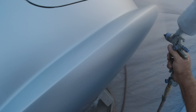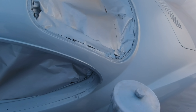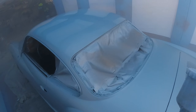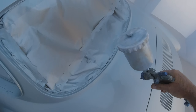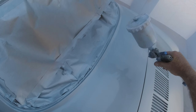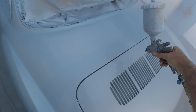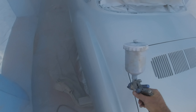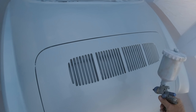There's really no such thing as zero orange peel — you always get some amount. Back in the old days with 60-pound guns I could get it pretty flat. If you're at home you're not going to spray at full pressure — you'd either paint about one panel or blow overspray onto your neighbors' cars. You have to turn the material volume down, which gives you better atomization and a finer spray.